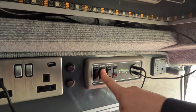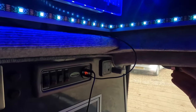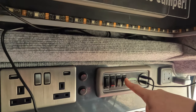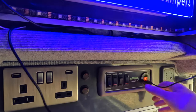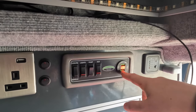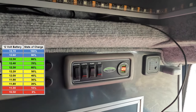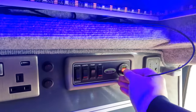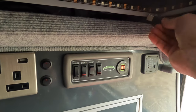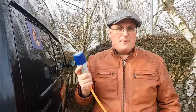We've got a switch for our lights and they work like this. The colored lights at the end are plugged in on USB which comes under auxiliary - if I turn that off they'll go off. Now you can see we've got our meter. When it says 12.8, that indicates the battery is fairly full without a load. When you start putting loads on and switching lights on, that should go down. When you want to check the condition of a battery, always check it without a load first.